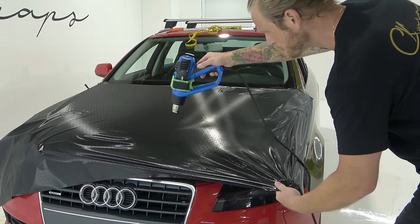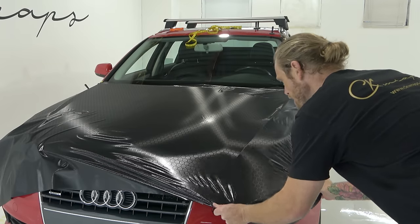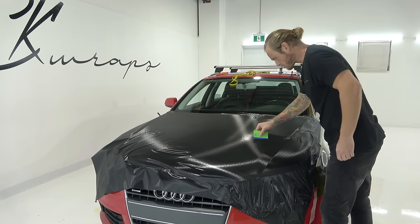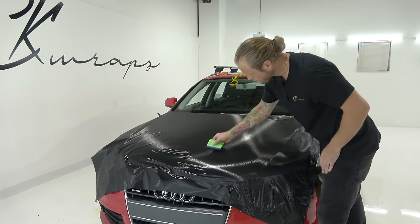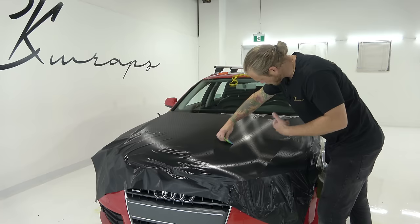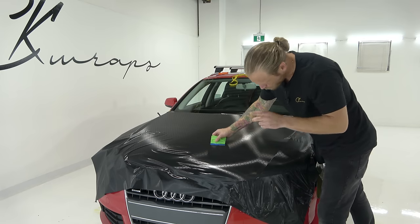We're looking good. We're going to take this area here and expand the film outwards, keep it nice and tight and bring it down in one pass. Boom — stick that to the light bumper. Let's squeegee out the air in this area here. Do you notice the pattern distorted at all? Because it's not — that's because we stretched over a large area. What we also notice right now is that the wrinkles are running across, instead of all that bunched up material running down. It's a huge difference — that is how you're going to be able to wrap your hood.